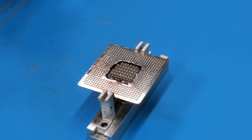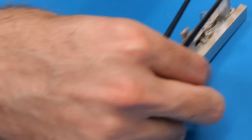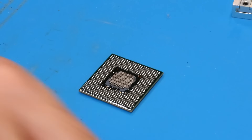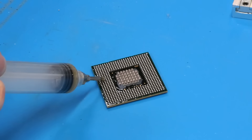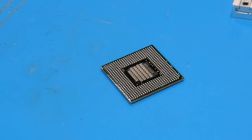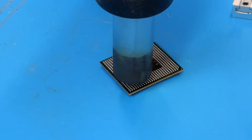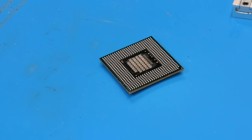That looks really good there. Now we need to let it cool down just a little bit and then remove it from the stencil. With the chip out of the stencil, we need to make sure there's a good amount of flux on there, so add a little bit extra if any pads don't have enough. Then go around and heat the chip one last time. With that final heating done, we're done with the re-balling — the chip is successfully and fully re-balled. All we need to do now is wait for the Core Duo logic board to finish in the dehydrator, which should take about two hours, and then we can get its CPU removed and install this one.